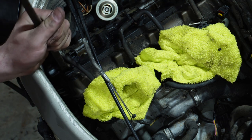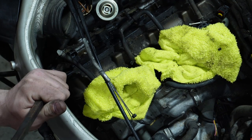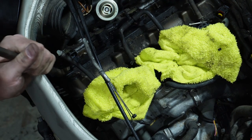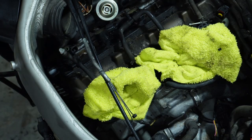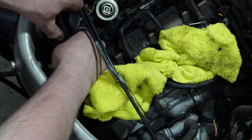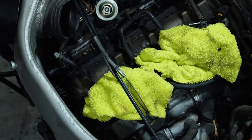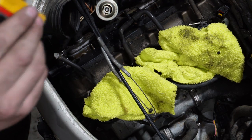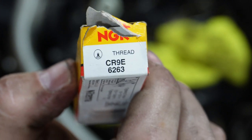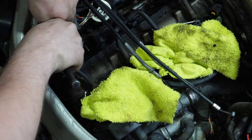Let's see if we can get these to pop out. That did work — okay, that was carb number one. New plugs going in are CR9Es, which hopefully is the same plug that's coming out. Limited space to work with on this bike, that's for sure — not super fun. That's going to be a pain to get back in, but I think it gives me enough clearance. After much struggle I was able to get the spark plug out. It's okay, not great — definitely needs to be replaced, so I've got the new one in there.